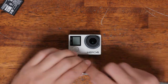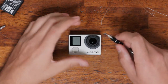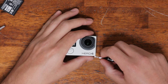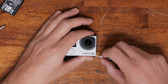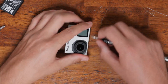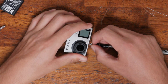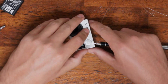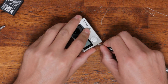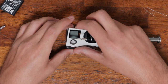We're going to start with a flathead screwdriver. You're going to take the plastic piece on the front off — there are small plastic tabs running all the way around. There's less glue holding this on than the HERO3 Plus cameras, so it's even easier to take off. Be careful when working around the LCD screen, as it's probably the only thing you could actually damage.